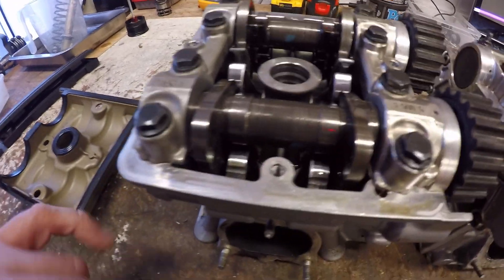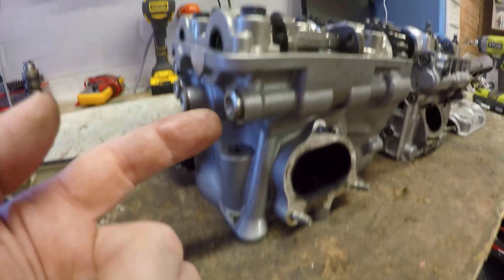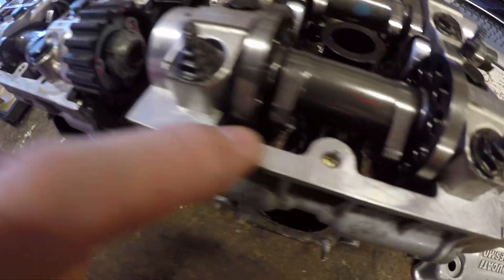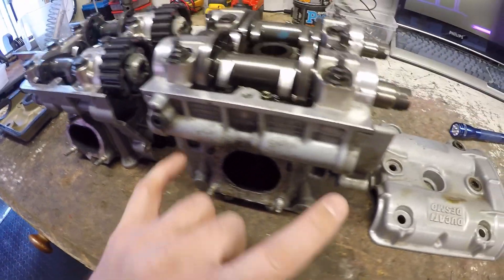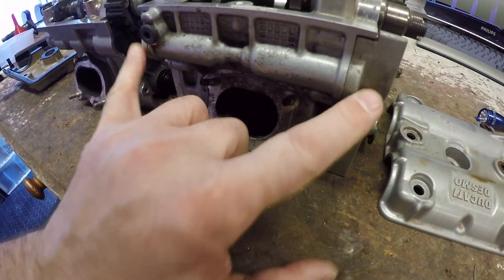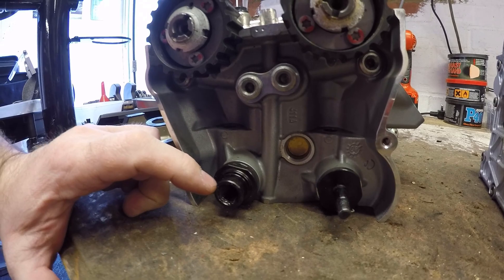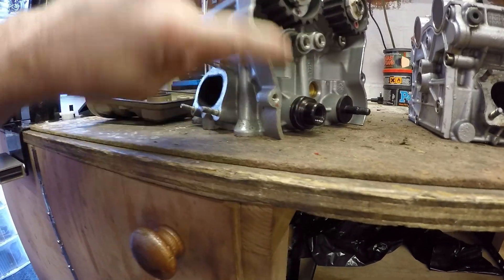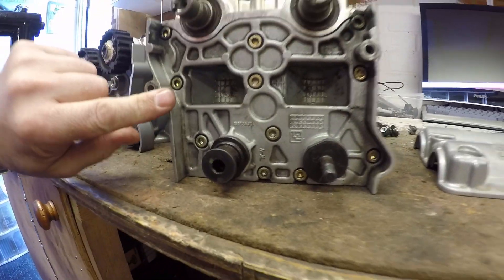The mounting arrangements for the arms are the same between the two engines — there's a machined gallery where pins are fitted and the arms mount inside little pockets in the head. On the earlier engine you have to take the covers off to remove the pins, which means going through a lot of seals on both covers, whereas on the later engine you've literally just got copper washers behind each bolt. This makes shim adjustments far easier, and the belt cover holding arrangement is also integral to the later head rather than part of a separate side cover.